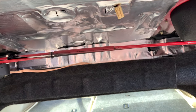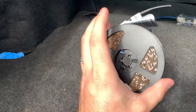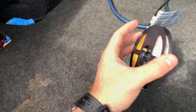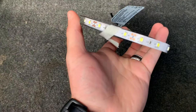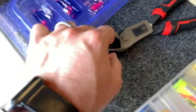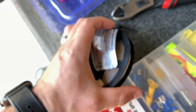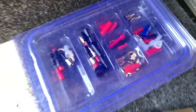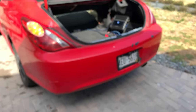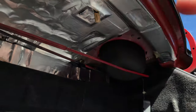I'm going to put a multimeter up to it and see if the voltage is right around 12 volts when the trunk is open, and when the trunk is closed it should be at zero volts. That will save a lot of hassle — you won't have to put an actual switch, and you won't have to remember to turn the lights off every time. I got these on Amazon, really cheap. They're white LEDs and 12 volts. I already chopped the end of the connector off. I'm going to strip the wires — positive and negative — and use quick connects to hook up to the factory wiring. So I'm going to hook up the voltmeter and see what the voltage reads.